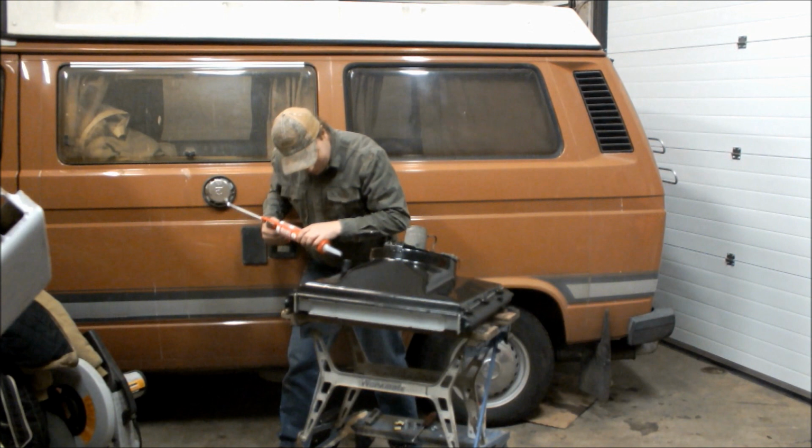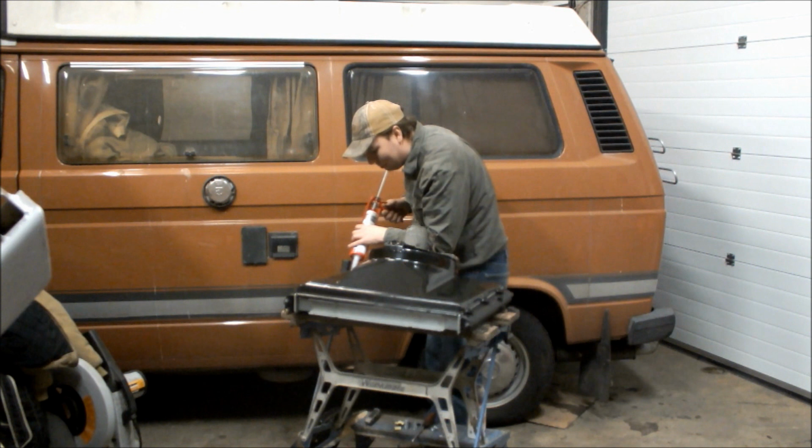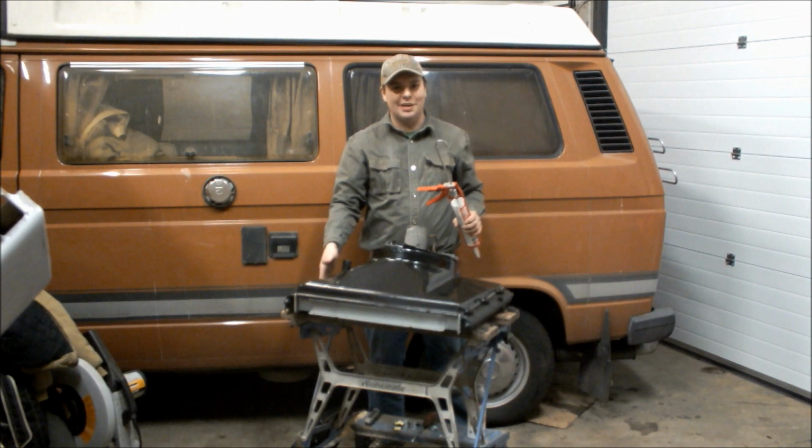You'll be able to get this off again if you ever needed to. Just run. That's why I haven't put it on first. It's only sat around the outside edge. You could have put it on first and really bed it down into it. But at the end of the day, the bolts are there to hold the cowling on. The last thing you want is to find you need to change this fan because it goes out straight away, and you're going to destroy the radiator and cowling trying to get it apart. So yeah, just put it around the outside edges.